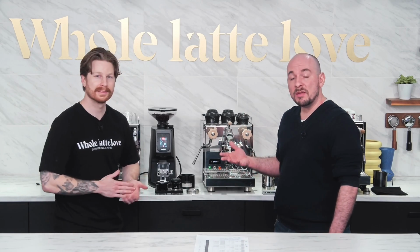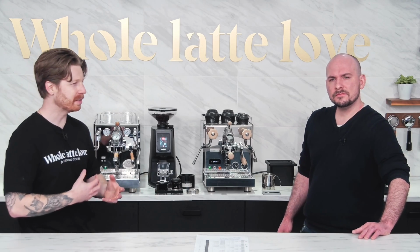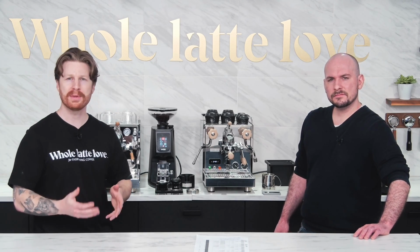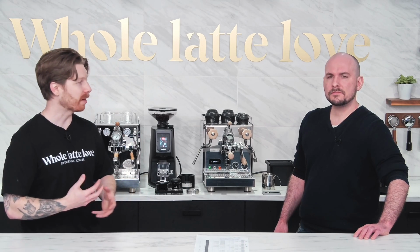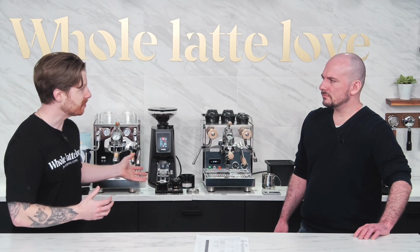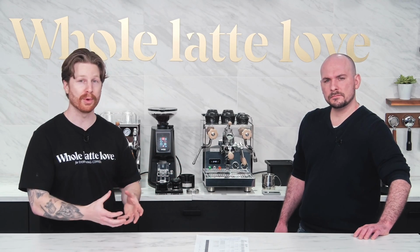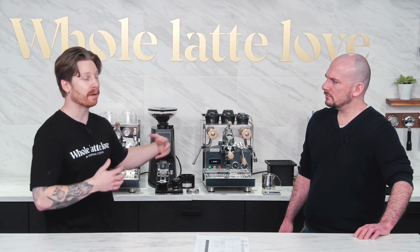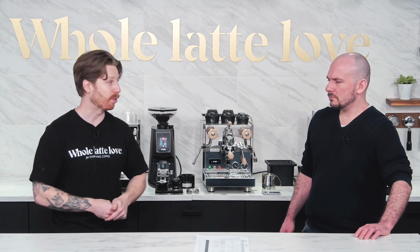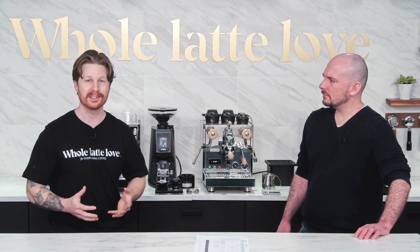You can brew and steam at the same time, right? Oh yeah, that's the best part about it. So if you're starting to get into maybe a faster morning routine is what you need in comparison to maybe a single boiler where you're waiting a lot of time in between waiting for that boiler to warm up. Well, this actually utilizes that heat exchanger type boiler, so you can brew and steam at appropriate temperatures at the same time. So I can start pouring some latte art, might get a little better at that, or just speed up my process in general.